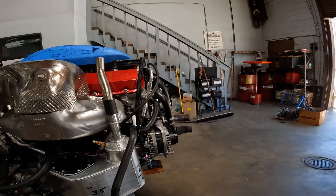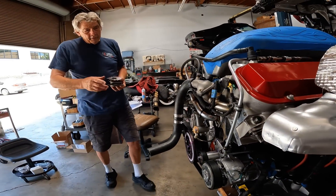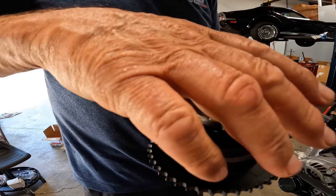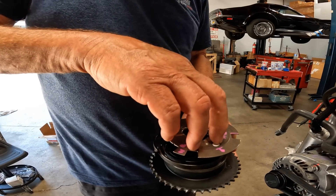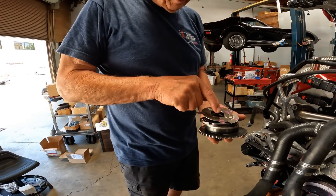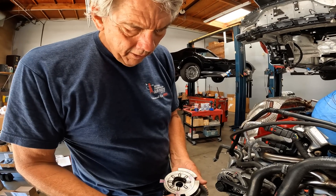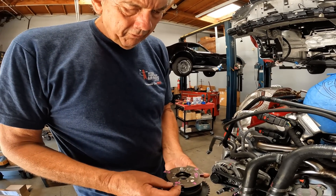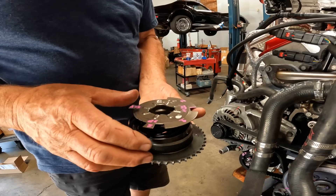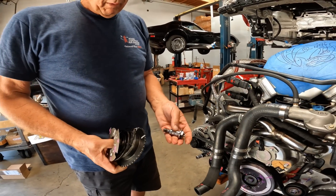Now to cut this one, we used a boring tool. This one we just chucked in the lathe and it was just spinning. This one we used a boring tool that came straight down and cut it this way. It was putting pressure downward and it didn't break all the spot welds inside — so that worked out good. After we separated the two pieces, we just reclocked it maybe two-thirds of a tooth, moving it 16 degrees. That put the leading edge 16 degrees in front, which basically replicates the 6.2 — the same position as a 6.2 — but now sitting on an 8.1.